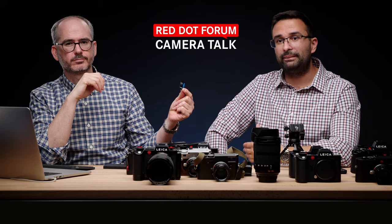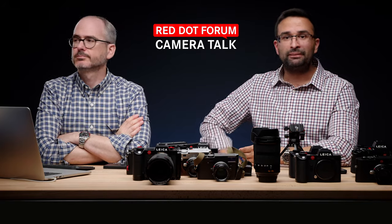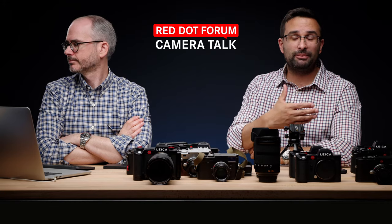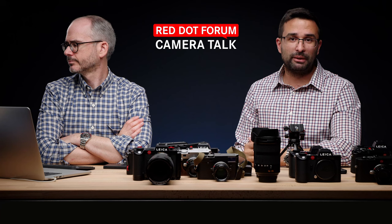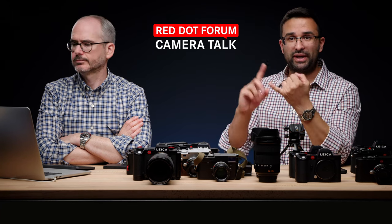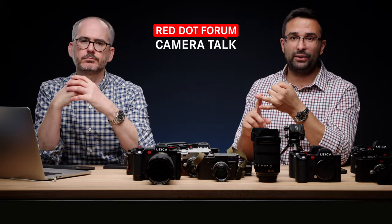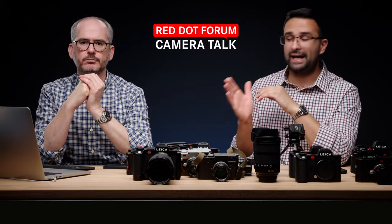When I say format, that means you're going to wipe everything off of the memory card. What you don't want to do is grab a memory card from your last trip that you haven't uploaded to Lightroom yet and start the firmware process with that, because you can't format it, or you wouldn't want to. So you have your camera, a fully charged battery, and an SD memory card that you can format. Those are the three things you need on the camera side.